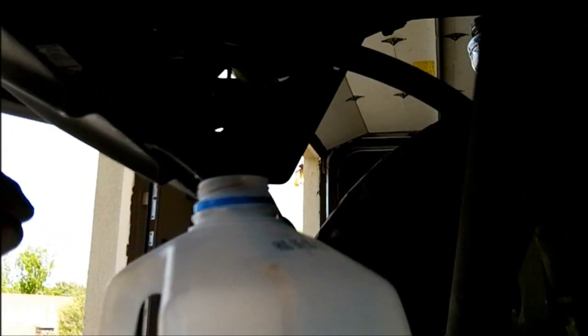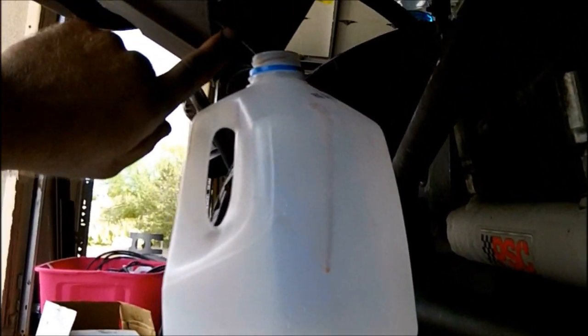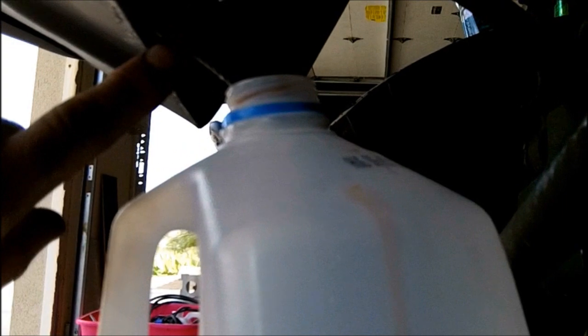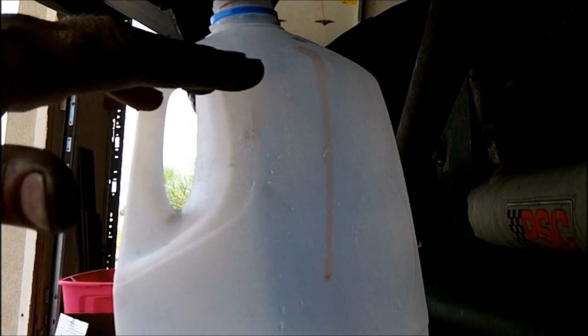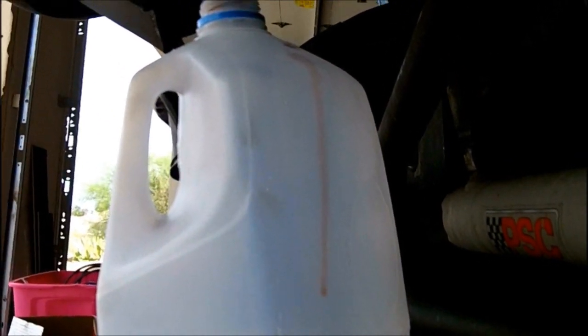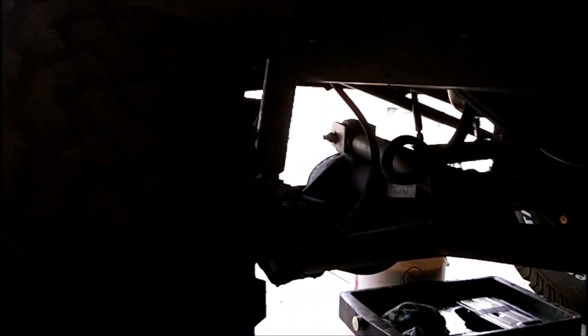All right, hopefully I can get a decent picture of this. What we've got to do here — I've got a milk jug. This is my favorite thing to use because it's one gallon. I've disconnected the line returning to the transmission after you go through your coolers, and this line will be going back to the transmission — dumping back into the pan, basically. Disconnecting that one into a gallon jug. We're going to fire the engine up. This is going to start filling up, and when it gets real close to the top, we kill the motor. Then we add four more quarts of fluid, dump this, and do it again. All right, I'm going to fire it up and we'll see what happens — if I got this wrong, we're going to have a mess.